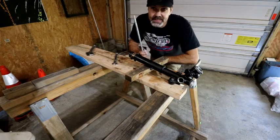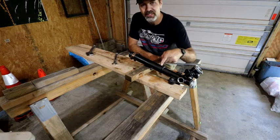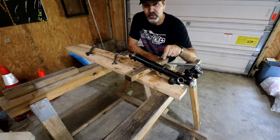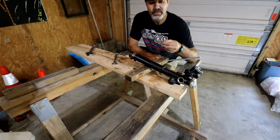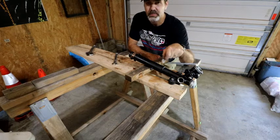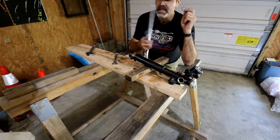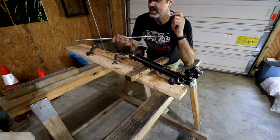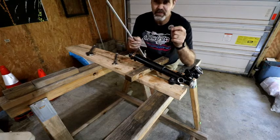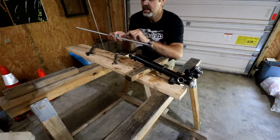All right, so it is completely another weekend. The seals that are in here, I need to get those out, and I have no tool that will reach in there and do it. So I've got a washer here that's the same size as the inside bore of the cylinder, or just slightly smaller. And then I've got a piece of threaded rod I just picked up at a local tractor supply. It's half 13 if you need to know, and I've got a couple of nuts jammed together here,